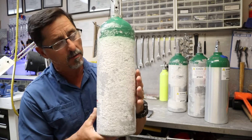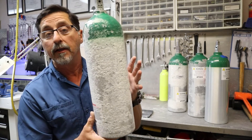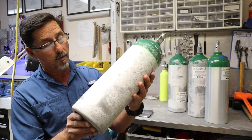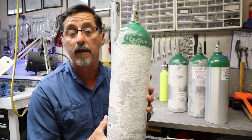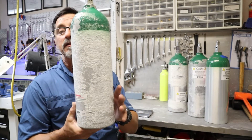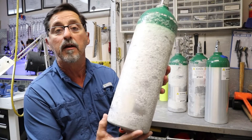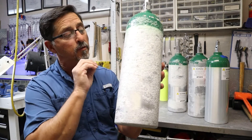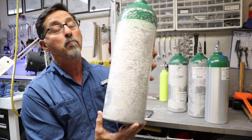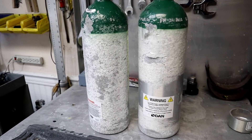These two I'm not too sure about — I've been saving them. I've got to scrape all this off. This is corrosion that got underneath the actual finish of the tank. If I leave it like this, I can't see what's there, I can't evaluate it properly — I have to get it off. This is oxidation that got underneath the finish, and if we leave it there, it's eating the actual metal. Before you know it, it's going to have large pits throughout the tank. It must come off.